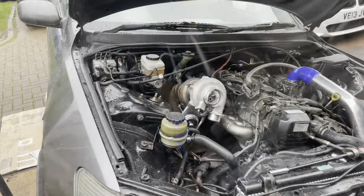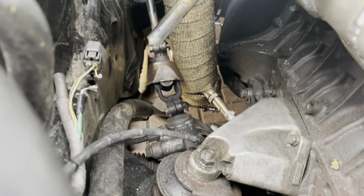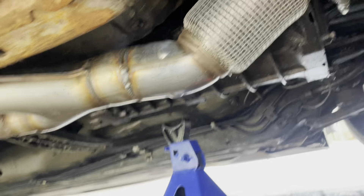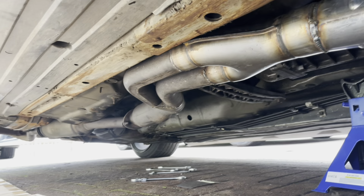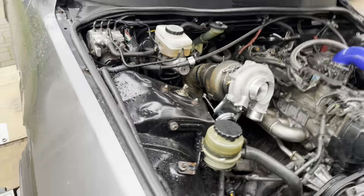I went and got a new bottle of gas because I ran out, and I've just started on the downpipe. The downpipe is now on — it's clear of everything, not touching the steering rack, with two lambda sensors underneath. It comes down into a three-inch system and then two inches on a bench run toward the back. There's an extra V-band there too. Everything is tightened up and nothing is knocking, so we're good there for part one of the turbo build.